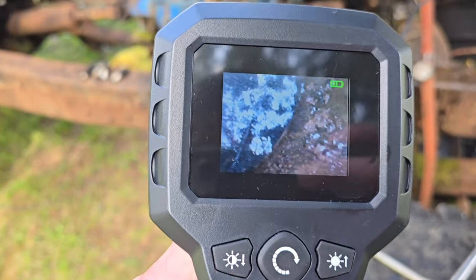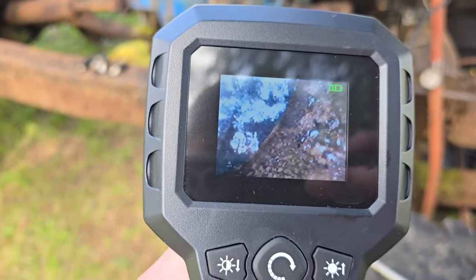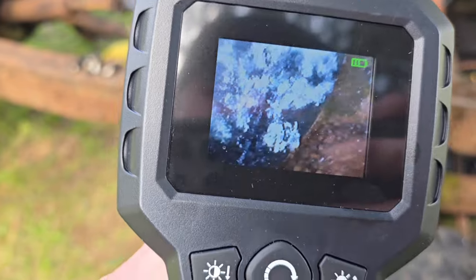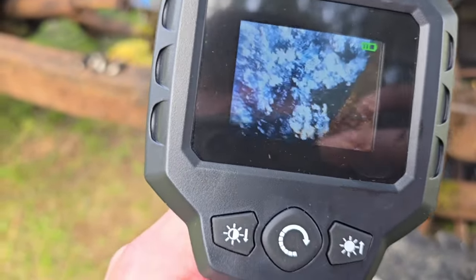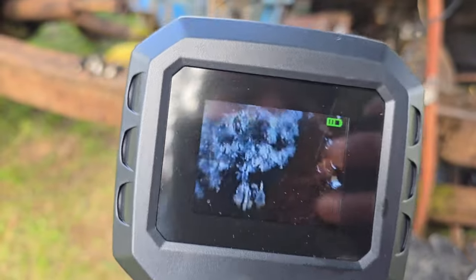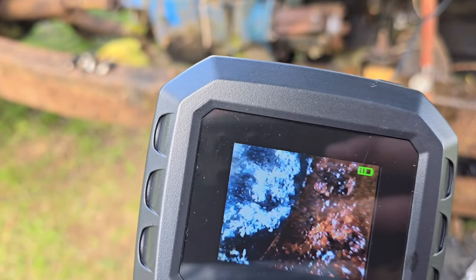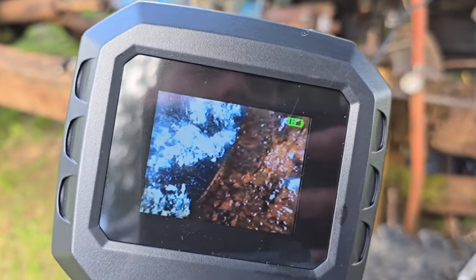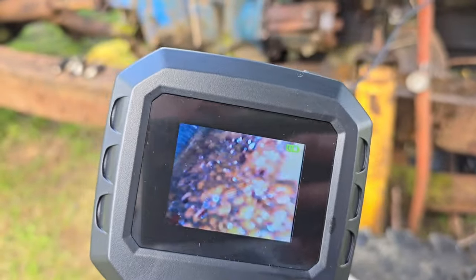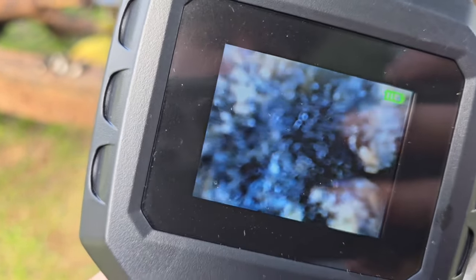Not good. Okay, first cylinder, passenger side. Really bad with rust. And even if I could get this thing to turn over, I mean, the block, the heads could be cracked on this thing. Ooh, yeah, that's pretty bad. From sitting and freezing and who knows. The only thing that could have saved it from freezing was maybe having oil in these cylinders. But yeah, it's pretty bad.